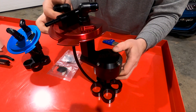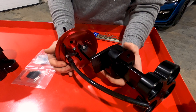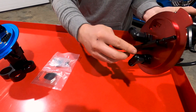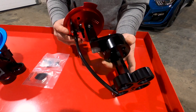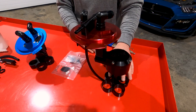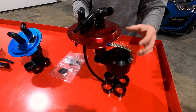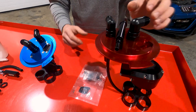Back to the F-150 — obviously it's a different type of hat, it's a lot more complex with a lot more pieces. The nice thing we did with the F-150, which was kind of a pain but needed to be done, is retaining the factory rollover valve. In these trucks there's a check valve inside the tank that works with all the vent lines of the pump. All these vent lines are retained, everything connects just like factory, and the rollover valve is still 100% operational just like from the factory. One of the main things we wanted to do when we built this pump setup was to not only integrate four pumps — which support almost 2,400 horsepower — but also keep all the factory features there for safety reasons and peace of mind.